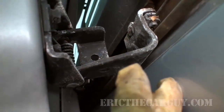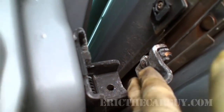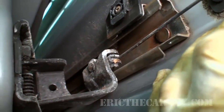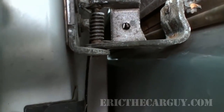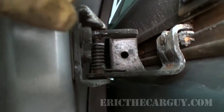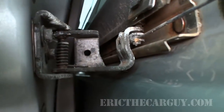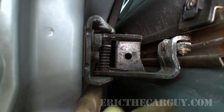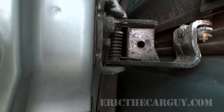Now I'm going to disconnect these two 12-millimeter fasteners — this will disconnect this part of the latch assembly from the door. Then it's a matter of removing these cables and reinstalling them, which may prove to be the trickiest part of this job. Before I remove this latch, I'm going to come in here with a Sharpie and draw around the outside so I know its location. This is critical for the door's alignment — if this isn't reinstalled correctly, the door won't sit properly and won't close and latch properly. We want to keep the alignment as close to what we have here as possible.